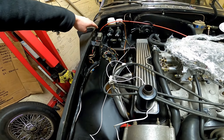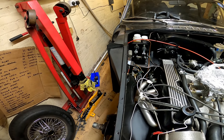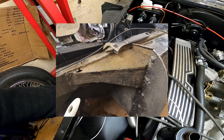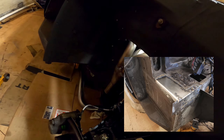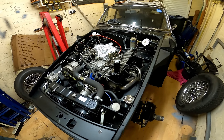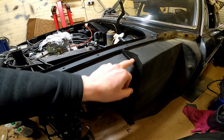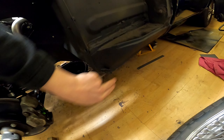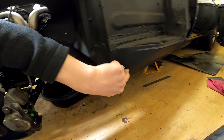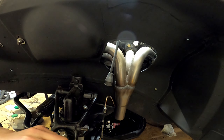We replaced a large portion of the wing - I've got photos so I'll add those in. Up here we've got the big cutouts for the exhaust to come through, and then the reinforcer plates we made. Exactly the same work on this side - new box, flag panel, new section here, and a complete new section of the front of the sill, with the same exhaust cutout.